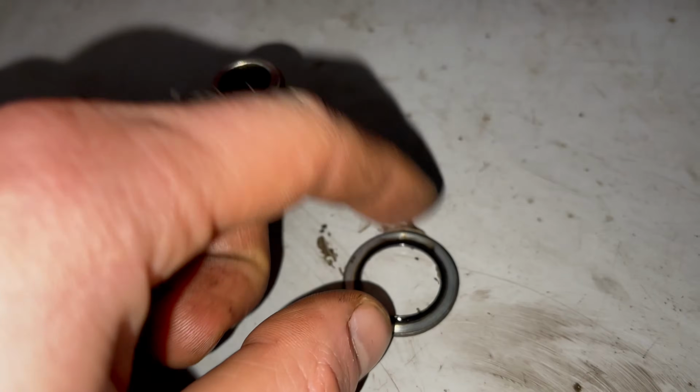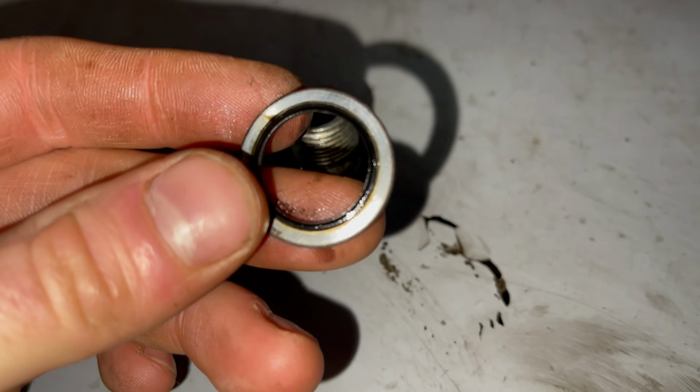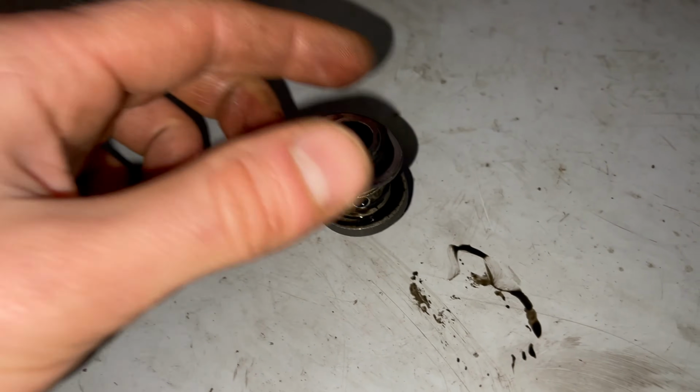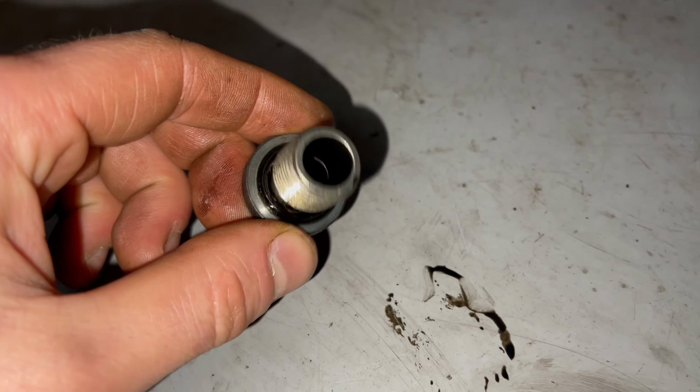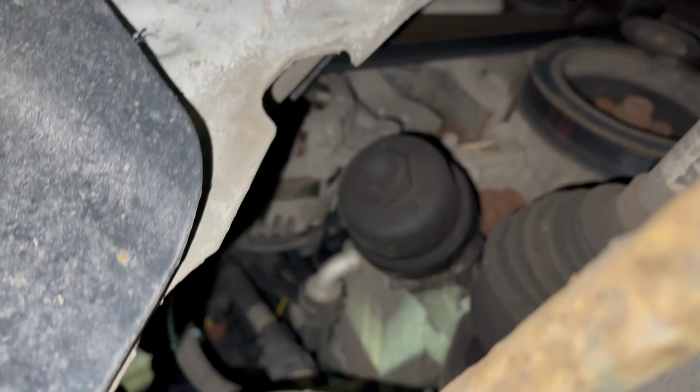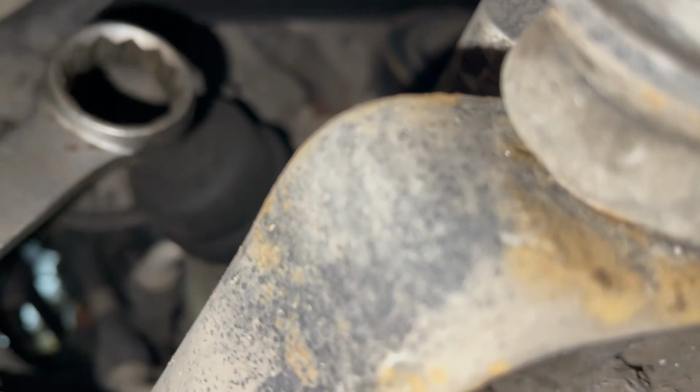We'd normally change the sump washer, but unfortunately we didn't have any of these in stock, so we had to reuse it. Obviously, after the service we took special care that the sump wasn't leaking. So I've replaced the sump plug temporarily at this point so that we can move on to the oil filter, which is very awkwardly positioned.